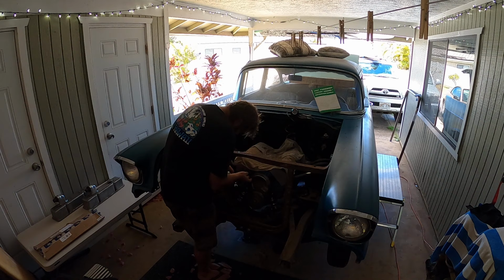because that stuff, if it gets in your oil pan and then gets into your pickup, man. But if you don't ever want to take anything off again, on a gasket that leaks or whatever, you can clean the surface and put this stuff on. Your intake front and rear will not leak. It's going to be fun getting it off next time, but that little bead that you put on the front rail, I use this stuff. That's what GM recommended instead of the gasket on the front.